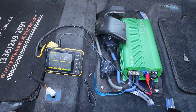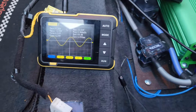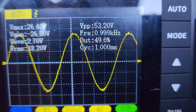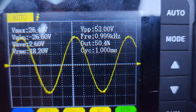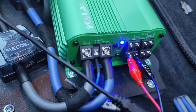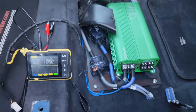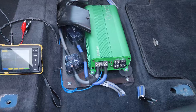Got the oscilloscope hooked up and we're about to set these gains at 1000 hertz. The clip light came on whenever I went up about another eighth or sixteenth of a turn, so I backed it off just a little bit and that's what it looks like. Both channels are set, the LOC is working good. Powered down — it took about two to three minutes to set my gains. Now I'm going to hook up the speaker wires.